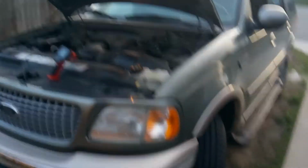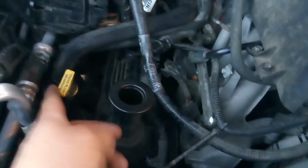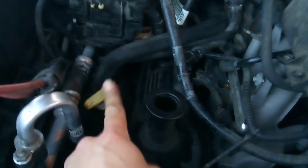As you know, it takes a lot to get this valve cover off. They're buried down inside of there. The driver's side is much easier to get off, but to get the passenger side off, you see all this wonderful stuff here? You've got to get that off and out of the way. That's basically all of your electrical connections and your computer, and those are coolant hoses, so you've got to drain a little bit of coolant.